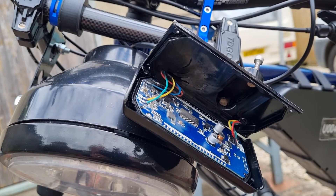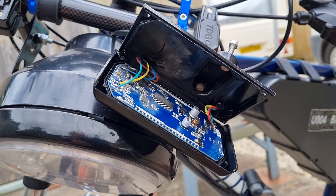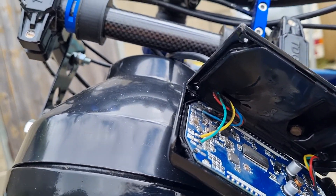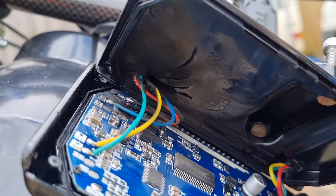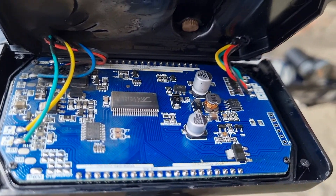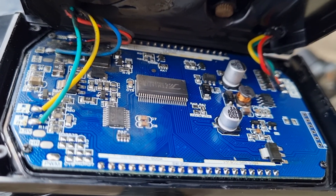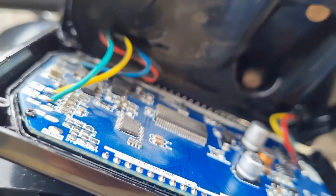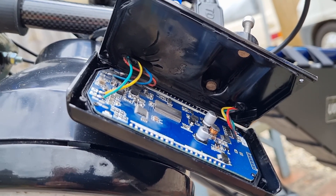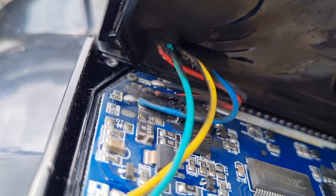Looking it up, I got an Error 10. An Error 10 usually points to something wrong in the LCD display. I opened it up this afternoon — very difficult to open because to a certain extent I'd heat-welded it closed from the inside. But that shows you what's on the inside of the LCD; if you want to poke around, that should give you some idea. I can still smell some of the electrical burning smell — PCB burn. I've got a new one on order so I'm just going to do a straight swap, not bothered looking into what the exact issue is. It looks pretty well fried in that corner in totality.